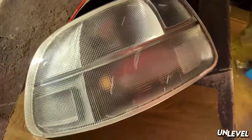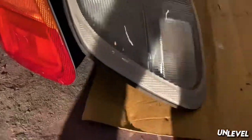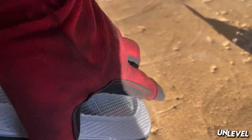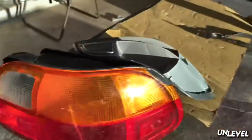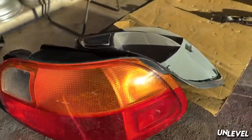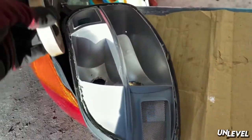I got one of these lenses locked up here. These don't have any kind of a lip on this side so they can sit inside the groove. What I'm going to do is use headlight butyl and go all the way around - give it a surface to lay on, but also give it that weatherproof seal it needs so water and stuff doesn't get inside. I might need to go buy some more; I didn't realize I was so low. It should come out pretty cool looking once it's done.